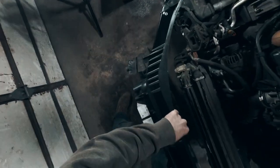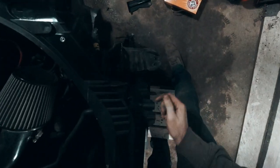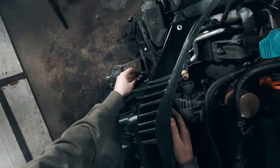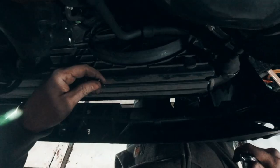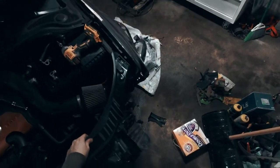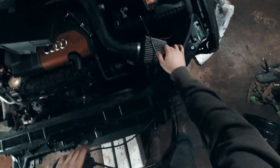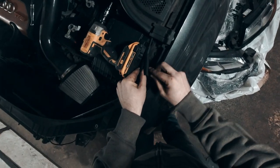I'm not excited for this. Scoop everything up, get it all in there, nice and good, and then just kind of lift it all up and start threading a bolt in. Do the same for this side, kind of get it in place. I should probably put these in while I have access — just so if they want to put the stock intake back on or that little cold air thing, they'll be able to. This gives me the opportunity to start running everything while still having some movement. Hood release cable goes through, and let's just lock that in, pull that tight, and clip this down.